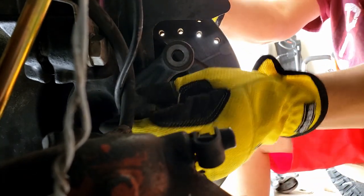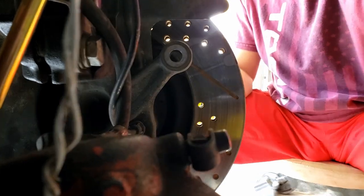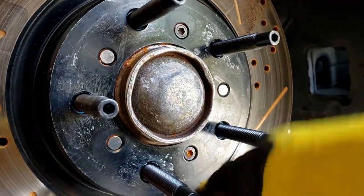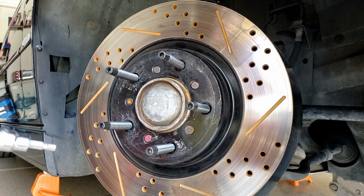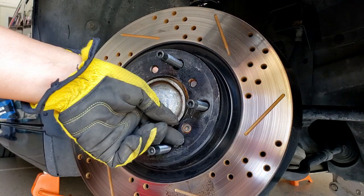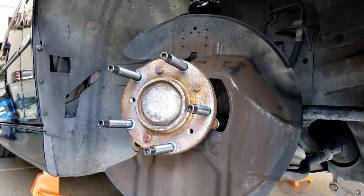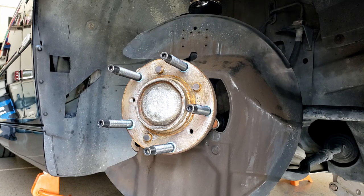Since the caliper is out, the next step is to disconnect and take out the rotor. To take the rotor out, there are two Allen wrench bolts here — five millimeter Allen wrench. Now the rotor comes off. I'm just going to put the screws back in so I won't lose them, then set the rotor aside.